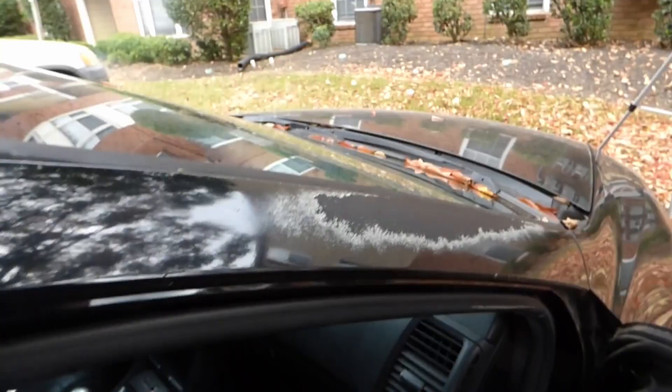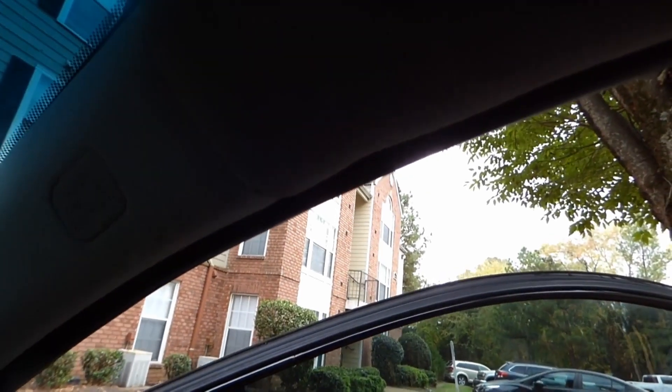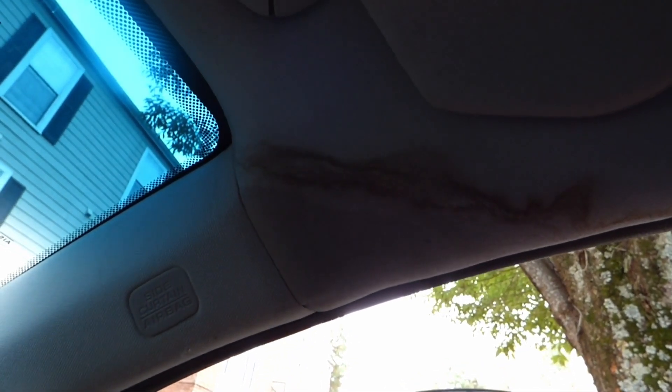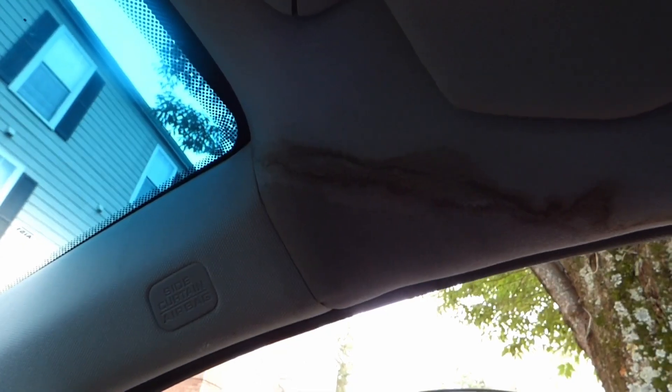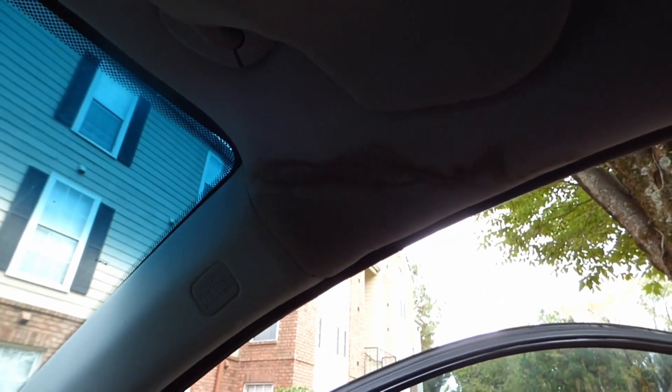And then we can take care of the stain on the inside of the headliner, which unfortunately I had replaced. Actually there's some water right here, so I know when I poured water right in that roof channel, that's where it was leaking. In order to get rid of this stain, I'm going to try maybe some OxiClean or something with a little bit of bleach in it. Because of the light color of my headliner, I don't think it would be too big of a deal — but we'll see. Once I figure out something that will get the stain off, I'll let you know. I hope this video was helpful — let me know if you have any questions, and thanks for watching.